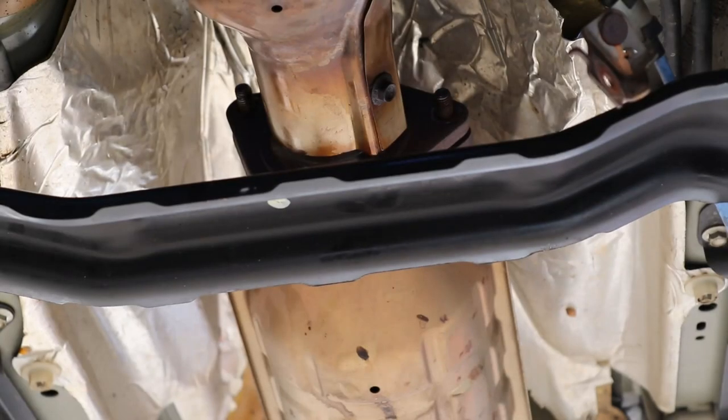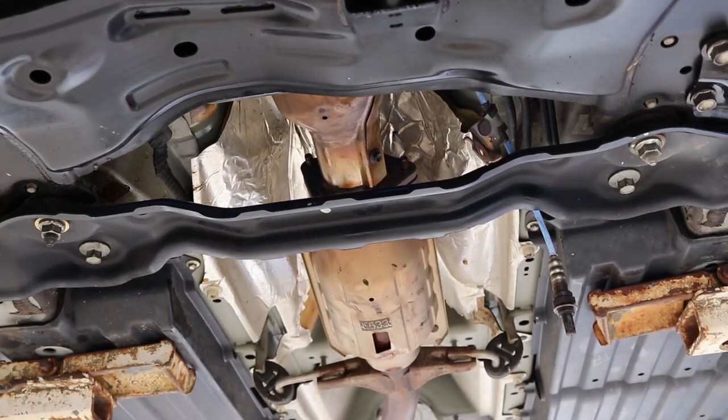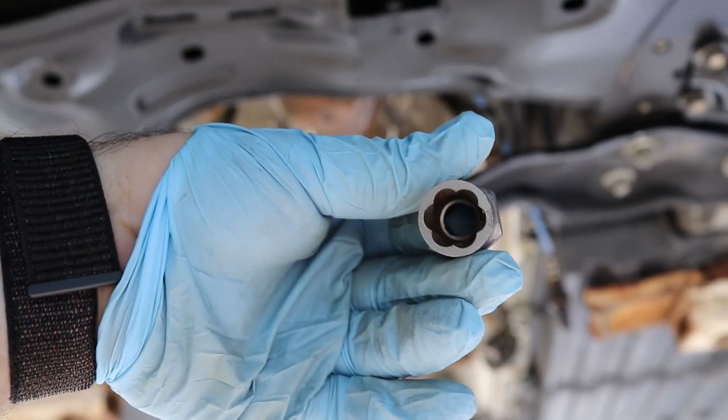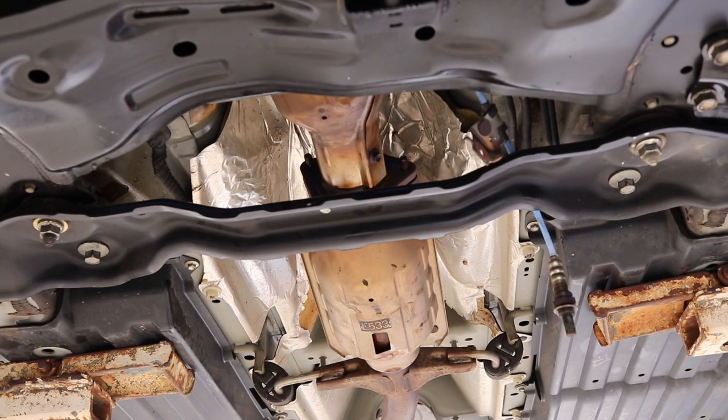Okay, so I got all three out, but I did have to use a bolt extractor on one of them. It was just too badly rusted. And that's a common problem with exhausts. This is what it looks like. It's fluted. And I will leave it in the description just in case you need them. They're great to have. I wouldn't have been able to get it off without torching it off without this.